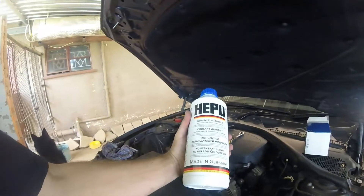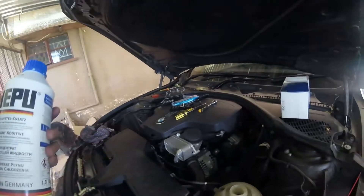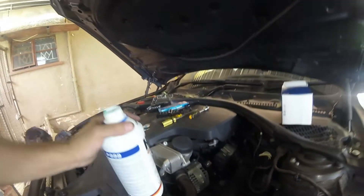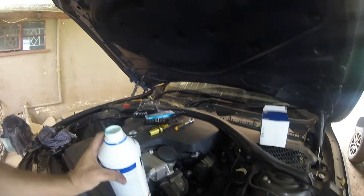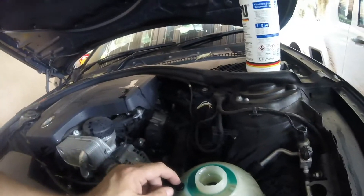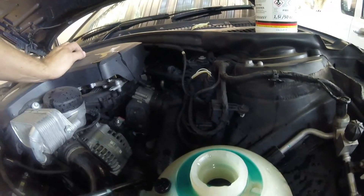The anti-freeze that I bought — this is the bottle. Normally, you pour in the blue anti-freeze in the BMWs. And if there is not blue anti-freeze in, don't mix the colors. If there is yellow in, you pour in yellow again. Make sure not to mix the colors. When you close all the bleed screws — this one at the bottom — finish pouring it. If the system has got enough fluid in, then you do the procedure.